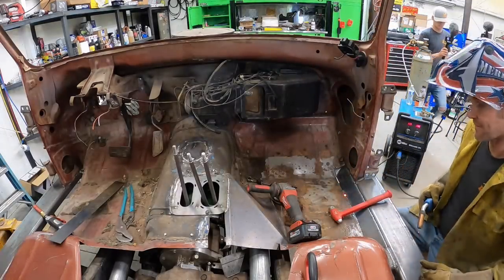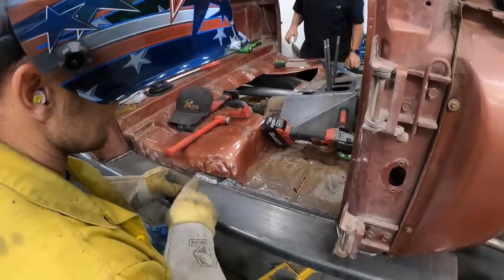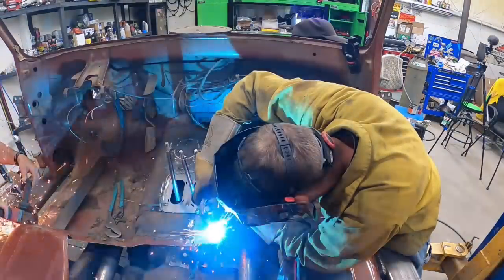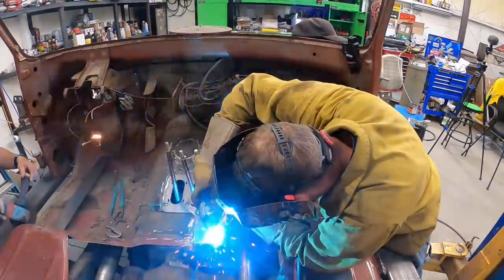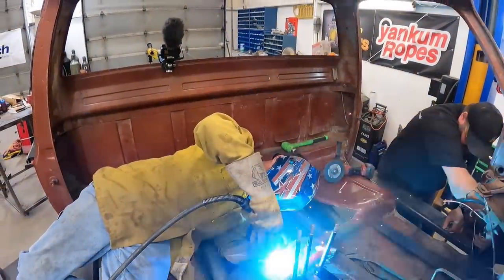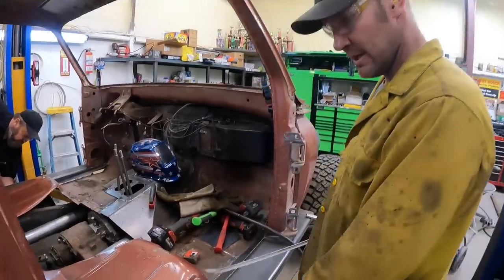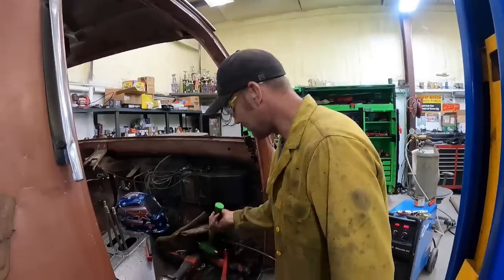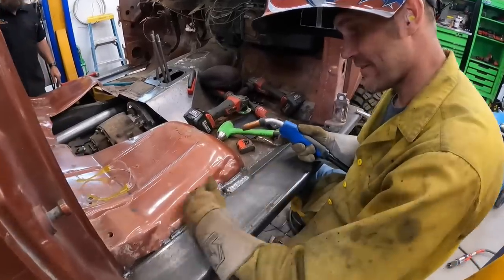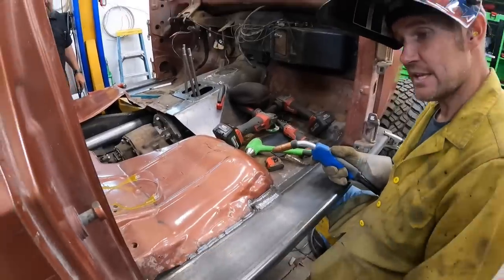It's a little rusty — we cut that section out. Give me a dimension to the plate. How about five by seven? We got the front pretty much all welded in now. I've got to get this back piece to bend up so I can weld it right down along there — might be easier said than done. We'll start welding and beat the rest out to match it. It's not smooth or flat but it's attached, and that's all it's qualified for. I'll fill that little hole up, pound that in and I'm going to eat lunch.